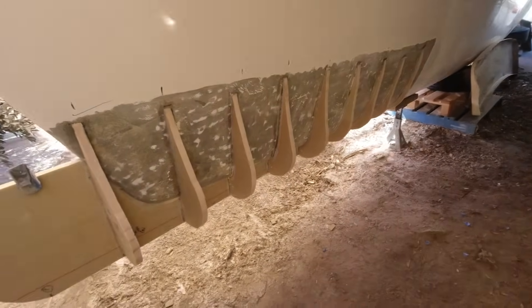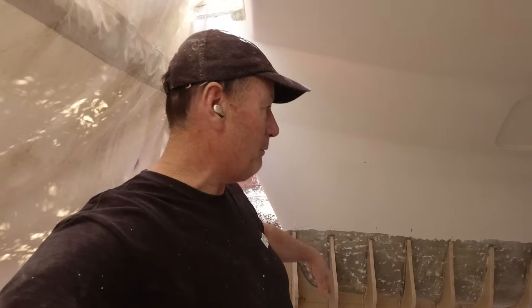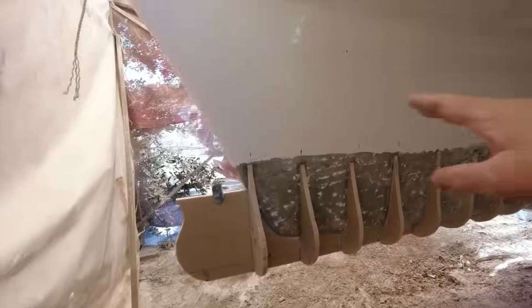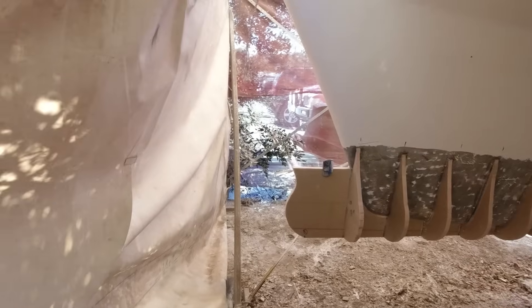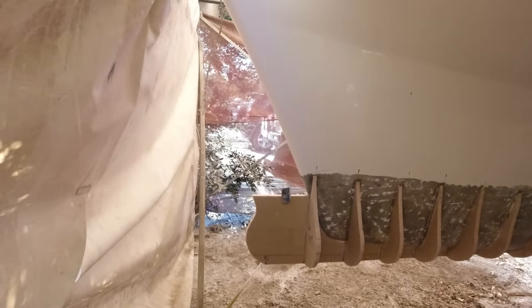I was considering filling this with two-pack foam, but the only real option is epoxy foam. I'm better off shaping it exactly as I need it rather than just pumping stuff in. That is going to be totally sacrificial material — if it cops a knock from a dock or a rock, the entire underneath of the boat, including a crash bulkhead, is basically sacrificial and can sustain a fair blow. Even the stem will be able to sustain a blow without undermining the security of the boat.